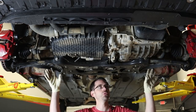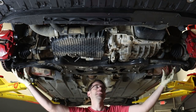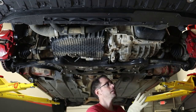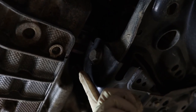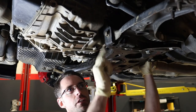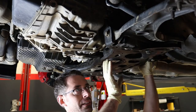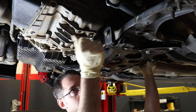These are pretty simple to remove and replace, with some caveats. The bolts we're removing are the two front ones, six outer nuts to the ball joints, and the one bolt in the rear. However, this rear bolt is blocked by the transmission — when you loosen it, it's not going to back out far enough. That leaves you two options: you can either drop the subframe down to allow the bolt to clear the transmission, or you can try to jack the transmission up, though that's limited by the engine mounts. Most likely it will require removal or loosening of the subframe to drop it down and allow this bolt to slide out.